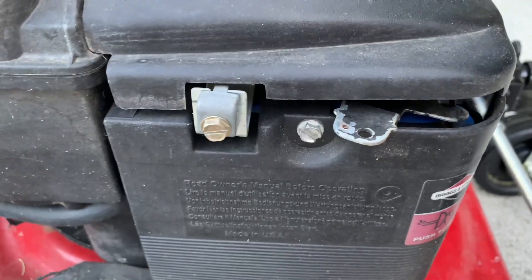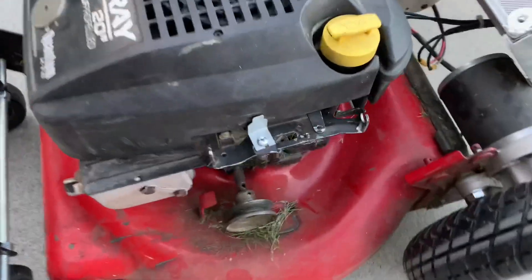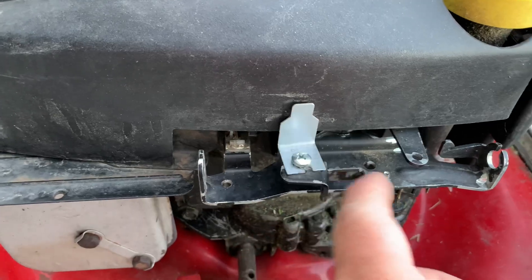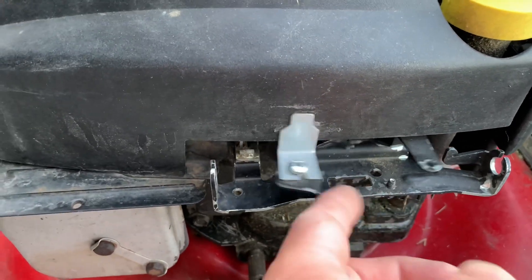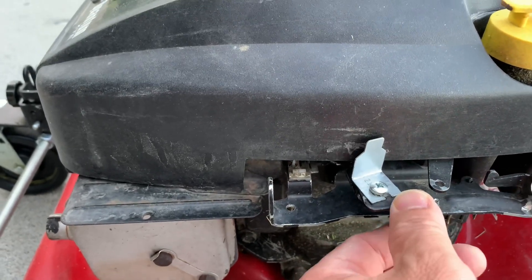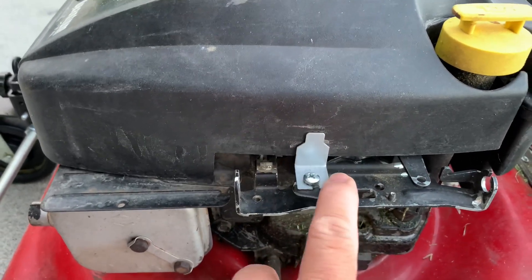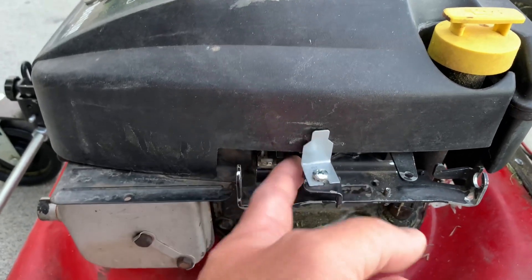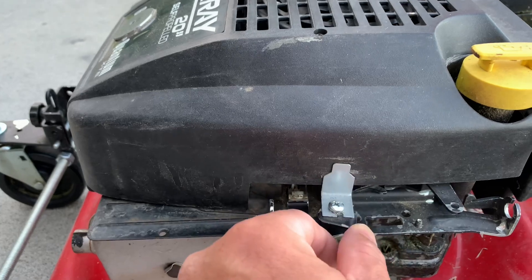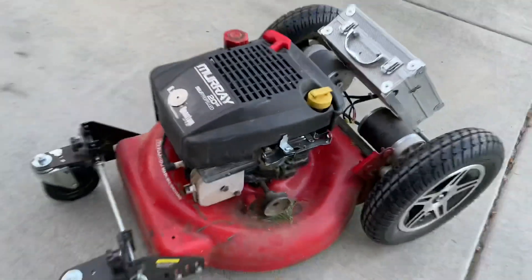This thing over here is what's supposed to be killing the engine — a safety kill switch. I set it up so when I need to stop I just do this and it kills the engine and stops. I didn't want to run it on this mechanism here because it keeps clicking and rattling badly — it has little teeth or something in there making a rattle noise when it engages. So I just stop it from running in there, like that.